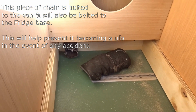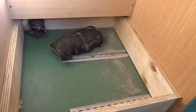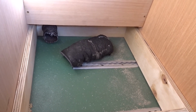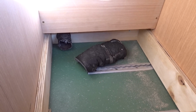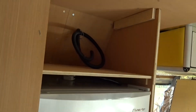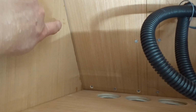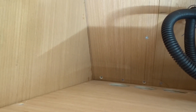And then here, as you can see, I've got one of the heater outlets which will come forward to this point here on a T and also go into the shower room, and then that's going to have a shelf on there. We will use this for storage. I'll put a hinge on the shelf, but this is going to have that black wheelie bin thing we've got, the thing we bought at the NEC several years ago, that we use in Woz. It's fantastic for keeping dog food in dog tins, and we also use it as a shopping trolley. So I've designed this cabinet very similar to the undercooker storage area. Up here, this may be an open cupboard, I haven't decided yet. I need to ensure we get ventilation there. The intake for the extractor fan into the shower room will be up here somewhere, so the idea is to pull air up through and then vent it out through the extractor in the shower room.